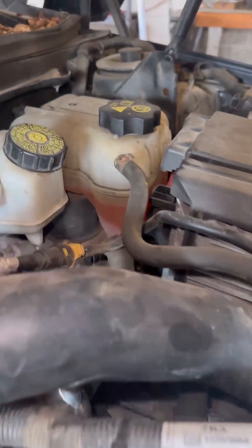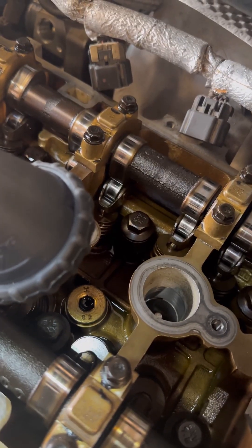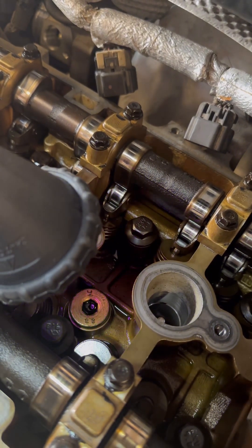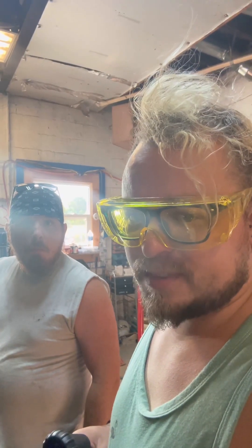You can see the coolant is not green in this system — it is red. So where did that little bit of green come from in the pan? Didn't come from the cooling system, so maybe somebody spilled some on it? If you spilled a little on the top, it would drain down to the pan. Was there some dye put in the oil? Let me know what you think, guys. There's more to the story than we're being told.